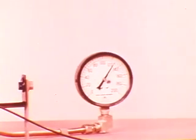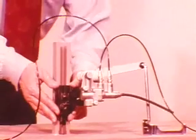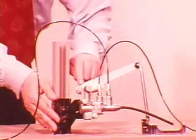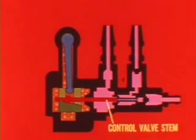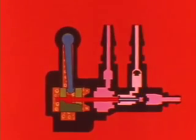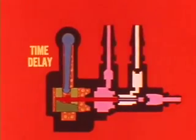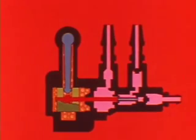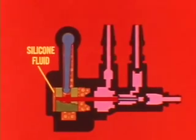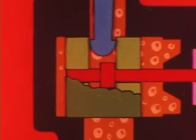Only when reserve tank pressure is lowered will the pump resume operation. Any time the car body moves downward to a position lower than the normal three-passenger height position, the control arm transfers movement to a toggle, which forces the piston to slide in one direction. As a result, the control valve stem unseats the valve and admits pressurized air from the reserve tank to the shock absorber feed line, and the shock absorbers start to extend. However, this action does not occur as quickly as shown — there's a time delay mechanism built into the sensing valve. Its purpose is to prevent road bumps or jouncing from making changes in car height position.